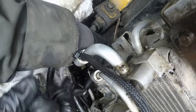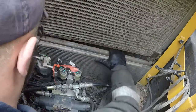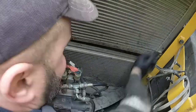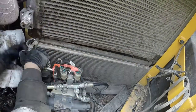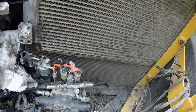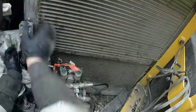There's a sequence you just need to follow — I needed to figure it out because there's no actual manual for this. Just take that rubber insulator and carefully work the AC condenser out — tilt it forward just enough to give room for the oil cooler to come out. They're a pretty tight fit, but just watch how I work it out to give you a visual idea of how to get it all out. It's all like one sandwich.